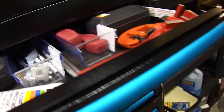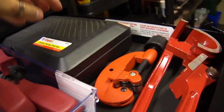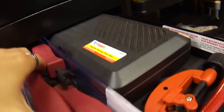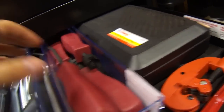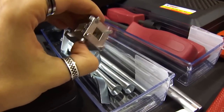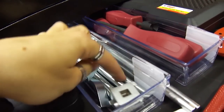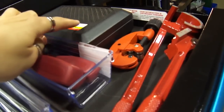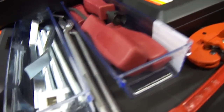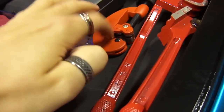The top drawer on this side is my brake product and brake tool drawer. I've got a metric bubble flare kit, double flare kit, and a tool kit to disassemble disc brakes — just different pieces to take the disc brakes apart. There are adjusting spoons, a caliper piston tool to screw the piston back in because some of them you've got to screw rather than just push. There are bending springs, an actual tube bender for when I'm doing flaring so I can bend the tubing. More brake tools, brake silicone lubricant for any squeal, and a cutter to cut the tubing.